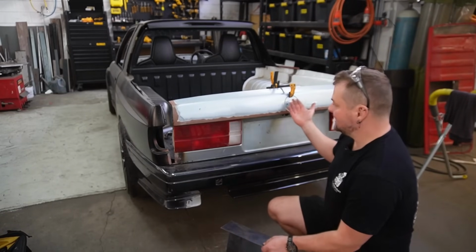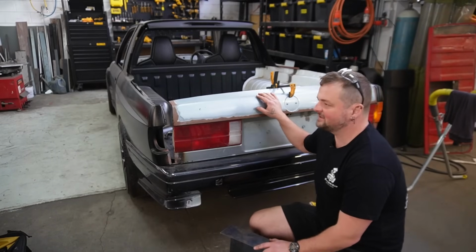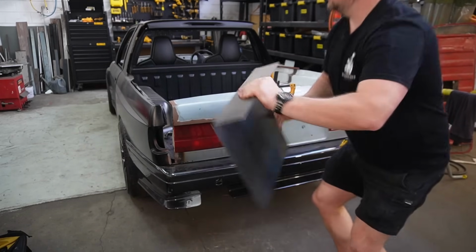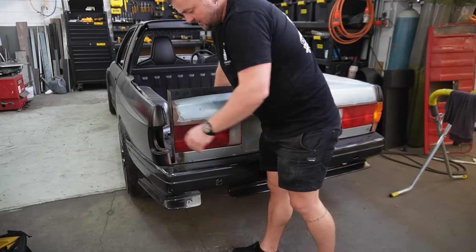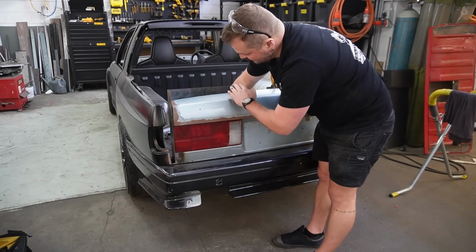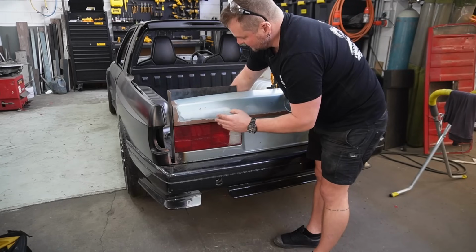Tailgate. It is clamped in, but it's sitting there properly. Damn that bone. Oh, good, someone answered it straight away. This is the panel. Now, it can sit on the inside, but I do need to cut out some of the inner wheel arch that I've made, and then once that's sitting down low enough, I can mark over the top and start cutting it down.